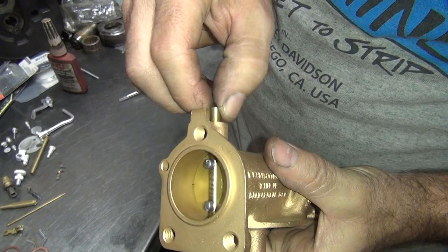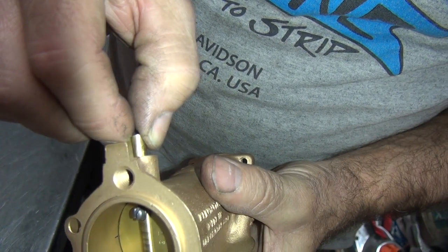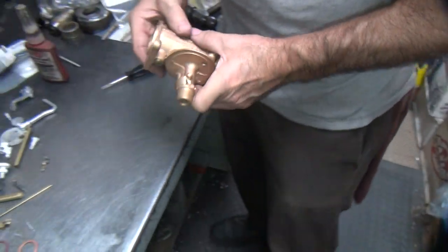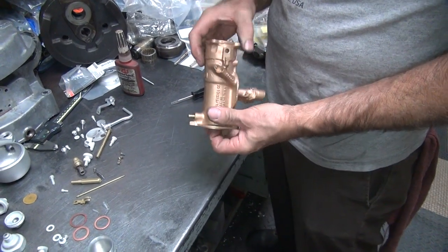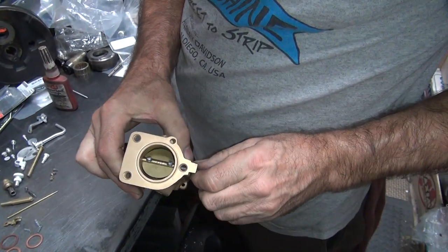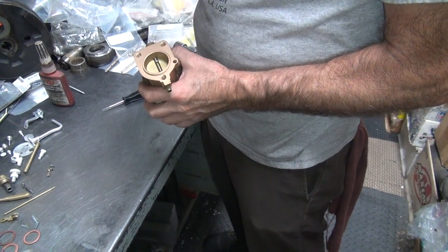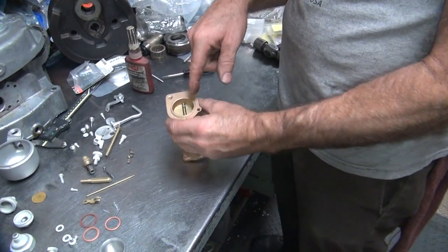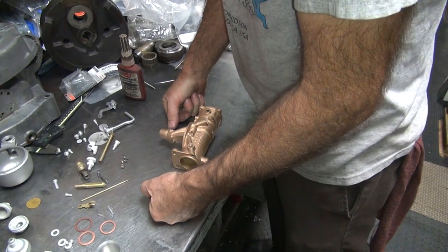See your transfer slot there? It's a little hole, and as soon as you open it up, the transfer slot opens up and lets more fuel in — fattens it up. As you go a little bit further open, it gets more and more fuel. So it fattens it up just off idle, limiting that off-idle hesitation. If you lengthen the slot a little further, it makes for bigger gains and works better. But if the throttle disc is wide open and the slot's all the way open, it doesn't get richer — it'll be a bog off idle. In that case, you put a little hole in your disc to let more air through so you can close the valve back up. Or you get one where the butterfly is a little worn — multiple ways of doing things.